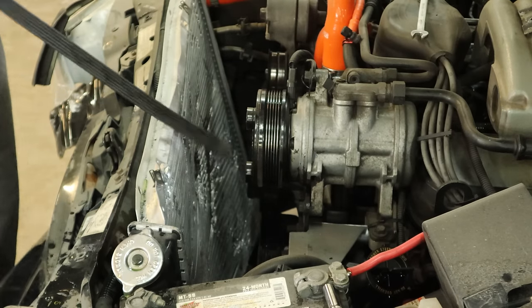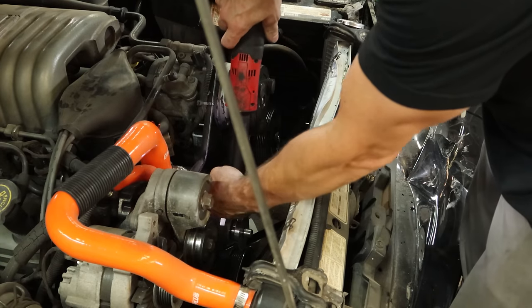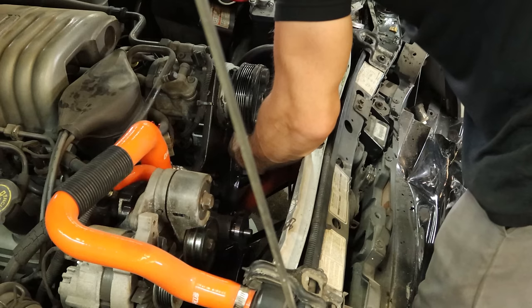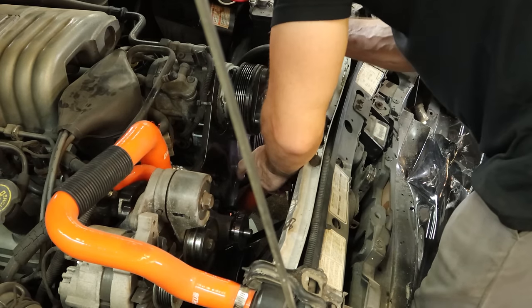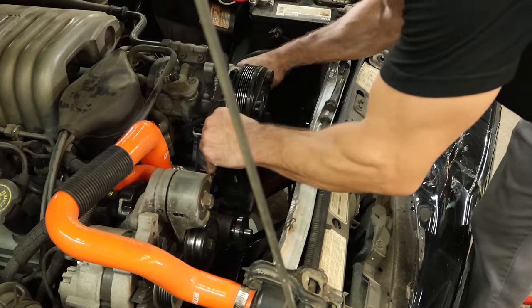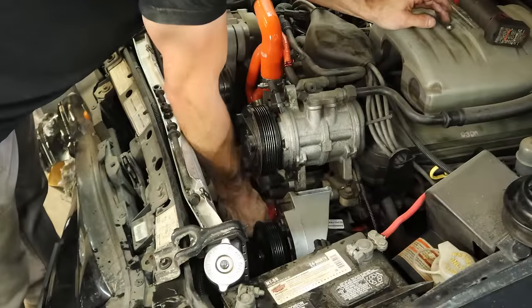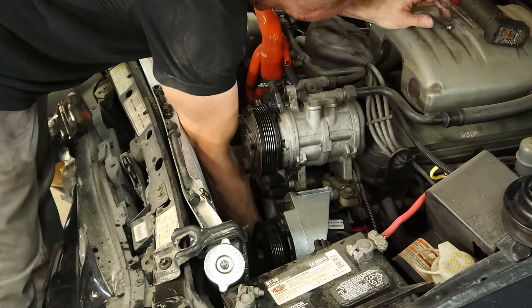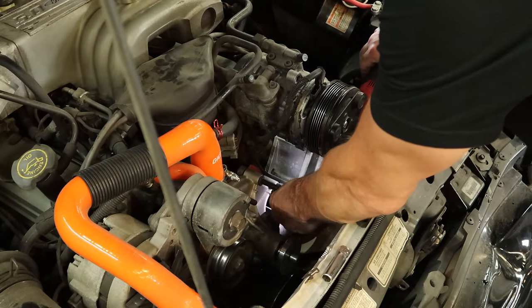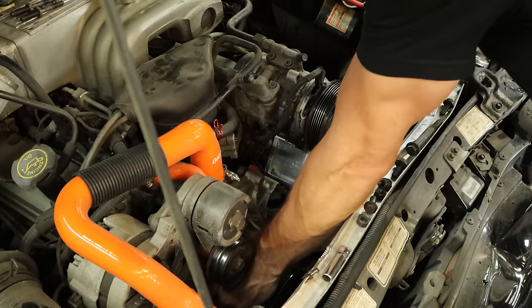Now we can get our belt out of the way. When the radiator went back into the fan, the fan went back into the water pump and it's a little squished — it doesn't spin anymore, and that causes other problems. We need to pull the water pump off and see if we can get it to spin and check for other damage. First we've got to pull this bracket off. We'll cut the factory zip tie — well, not really factory, but the plastic Ford used never lasted past about 1995 on a 1993. Pull the lower radiator hose off. We're going to start unbolting the water pump with eight different size bolts, ten different lengths. They did not make this easy.